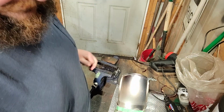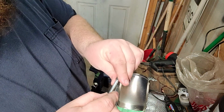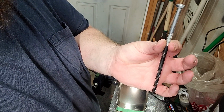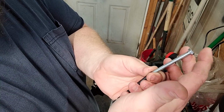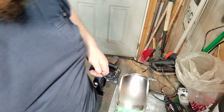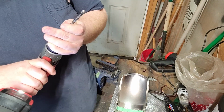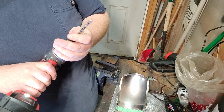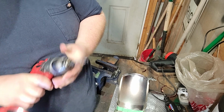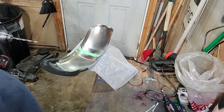Okay. You got that. Take your bolt. Match it up with your screw just like so. Or your nut or bolt. Yeah, bolt to the drill bit. Match it up. That's how you find out what size drill bit you need. But Luke does tell you in the kit. And if I looked, I would probably have that paperwork somewhere, because I bought two kits.